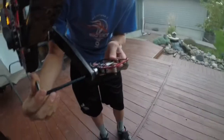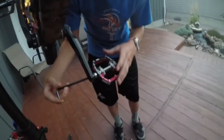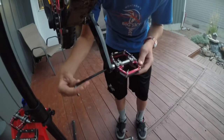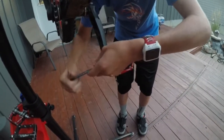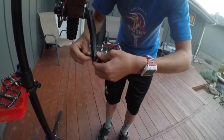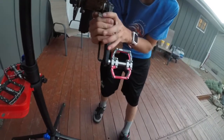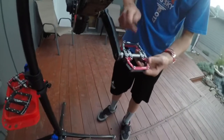I'm just going to do it with the Allen wrench since I already have one. This time you want to be twisting the pedal what would be lefty — you want to twist the pedal left from behind. Go ahead and make sure it's nice and tight; you don't want that coming loose in the middle of a ride. See, it's confusing. Make sure that's nice and tight and it will be on there. Sweet new pedals.